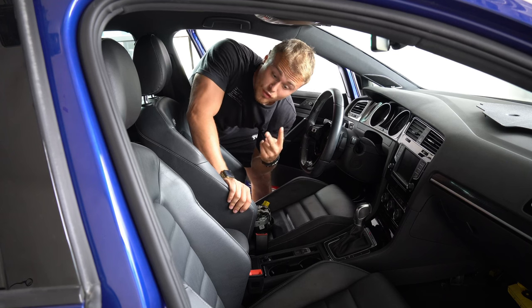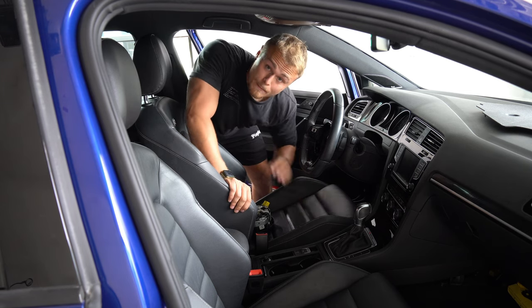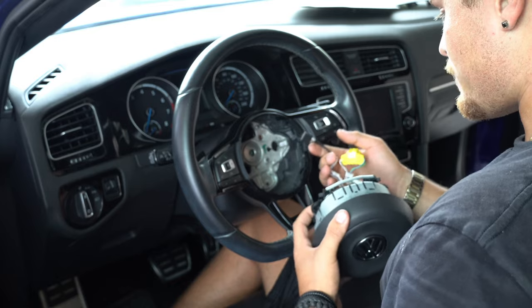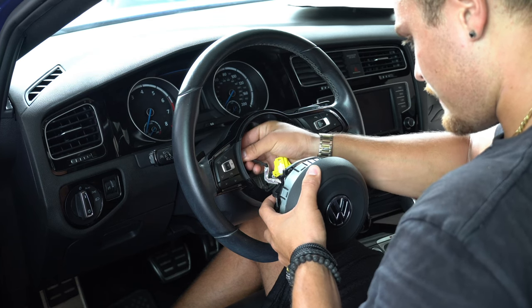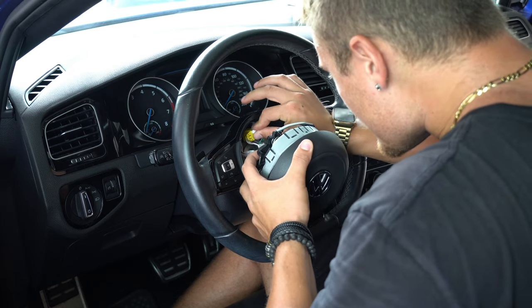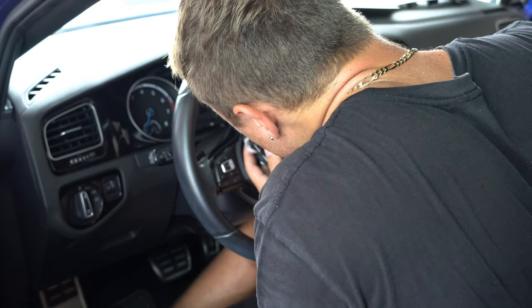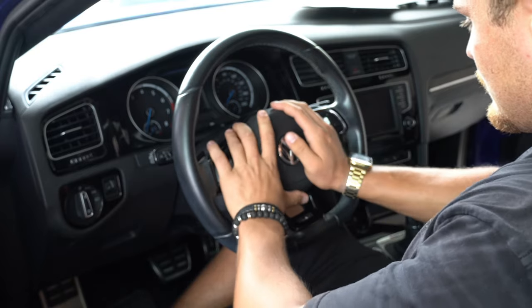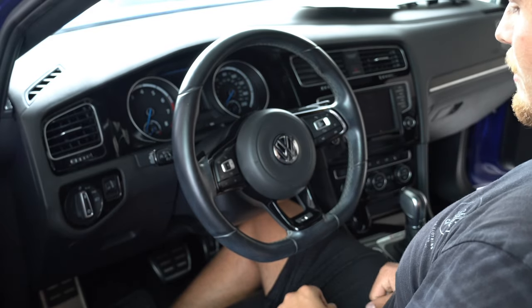In order to get to the last two bolts on the front seat, I have to plug the battery back in because the driver's seat is automatic and I can't just slide it back like the passenger side. But before I plug the battery back in, I want to quickly install the new steering wheel airbag. Installing this is super easy — there are only two connectors to plug in. The first one slides in right here, and the second goes right here: you push the yellow end and press the white tab down. Then we can slide this airbag in and just click it together. And now we have a new front airbag.